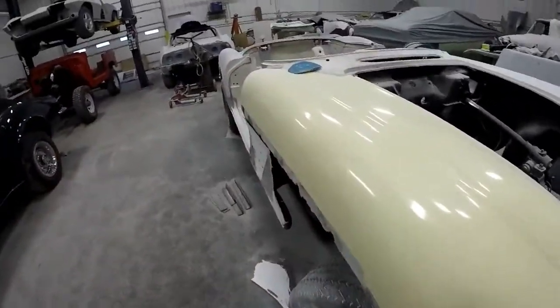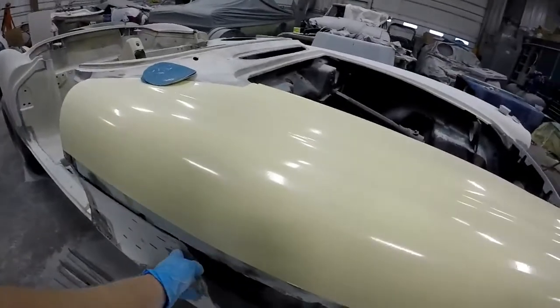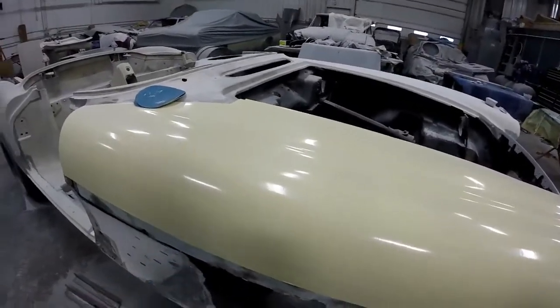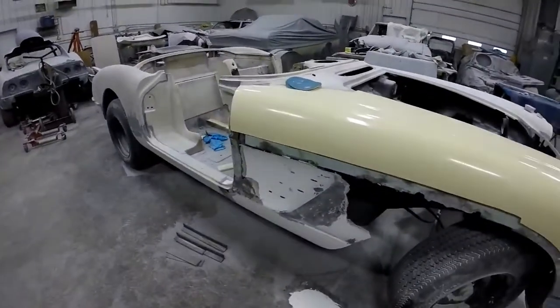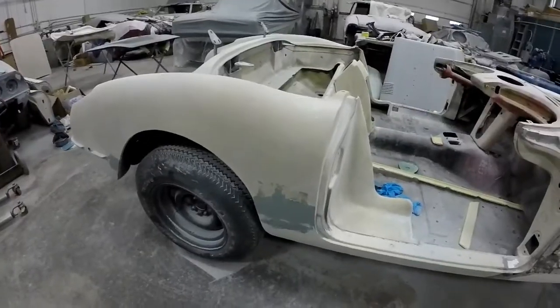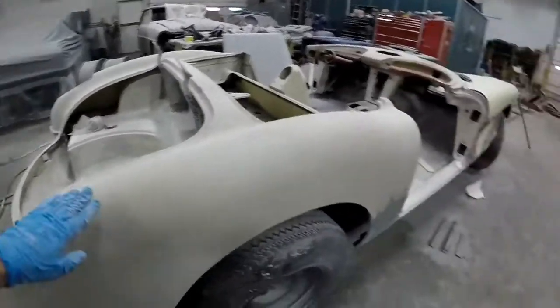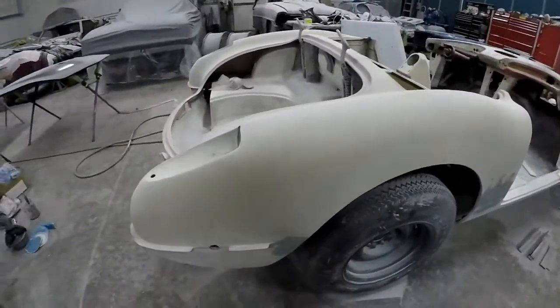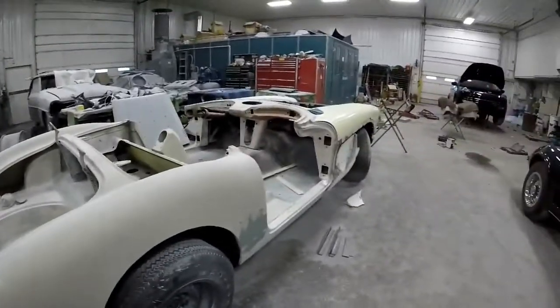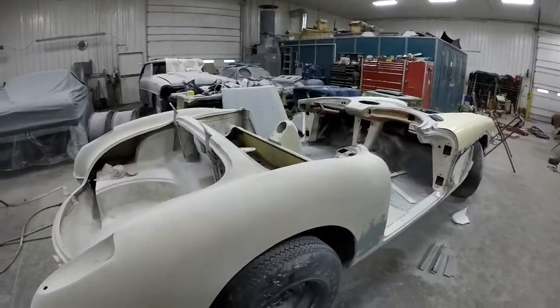So we have a new fender cap, and it's just sitting on top, so there's a couple inches height difference. So once the old one's off, it'll settle down a lot further, and we have a new cove panel coming that's press molded, not hand laid. So I'm holding off obviously on doing those joints, but other than that there's really not a whole lot of body work to do. I don't know if there's any bad ripples in the car or not, but just doing the seams, and then once that's done and the car sanded a little bit, it'll be ready for primer.